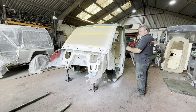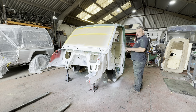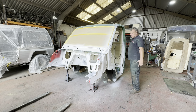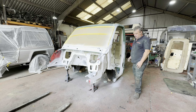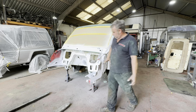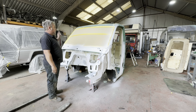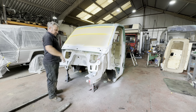I've quickly primed the bare metal bits and the door shut up to about half height — the rest is fine. I'm going to let this flash off a bit and then paint that bit, this bit, all through here, the inner floor, most of the inner cab, and the door shuts rouge.